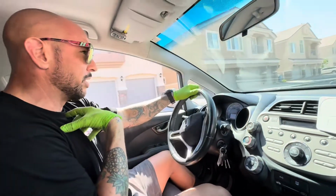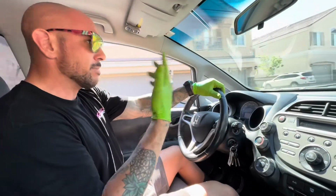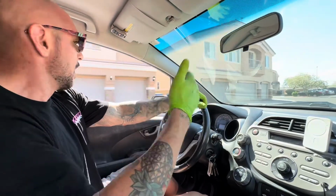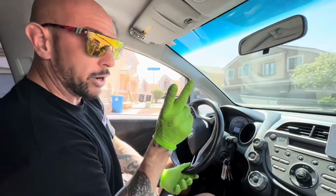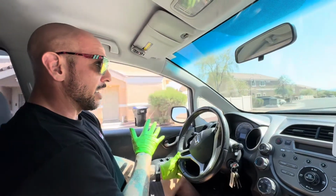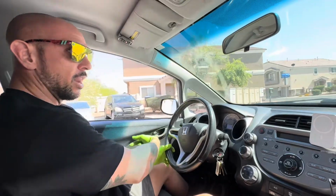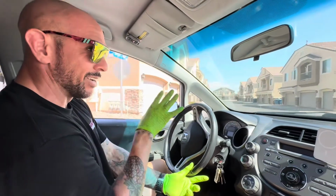Normally, at least in this vehicle, the lock was continually cycling. Every time you put it into drive and it started moving forward, it would lock and lock and lock over and over. This is a trick for any of you who are currently having this problem and maybe don't have the time to fix it: you unlock it manually with your finger and then lock it back. Eventually, if you keep doing that, it's going to strip the little gears in there and you get to replace the whole thing.